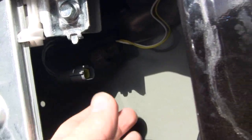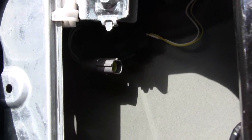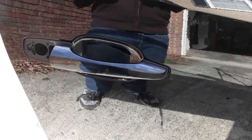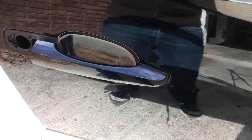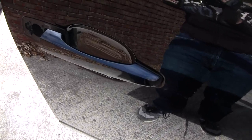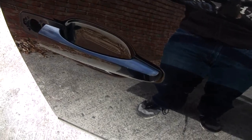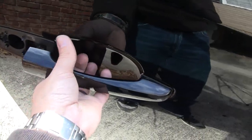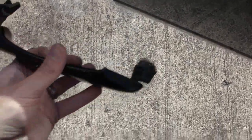After you've done that, go back inside the door and disconnect the plug from the housing — that's for the antenna that goes to the door handle, which is what we're removing next. It's a bit tricky to explain how to release the door handle from the internal mechanism. The best thing to do is get up there with a flashlight, pull on the door handle a few times, and get an idea of how it works inside and how it releases. It involves pushing the spring mechanism inward a little bit and pulling the door mechanism out. It took a few tries to figure it out, but once released, carefully pull out the antenna wire. The kit comes with new gaskets, which you might as well replace.